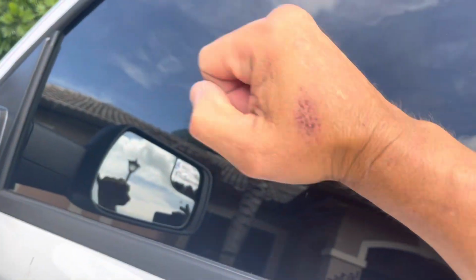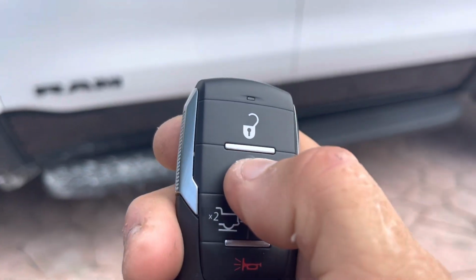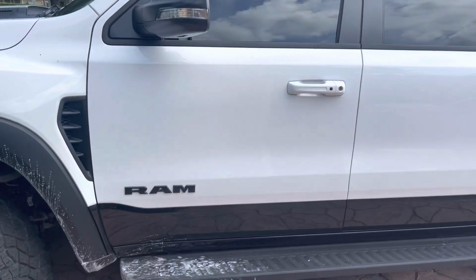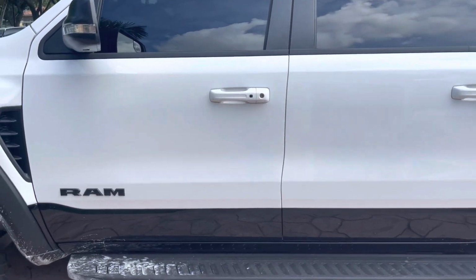I'm going to go ahead and beat on the glass now. Just one quick punch. Sets off the alarm. Go ahead and rearm it. When you arm it again, you can't beat on the car right away because factory alarms have a little delay. They take about 15 seconds and then I'll be able to hit someplace else in the vehicle.